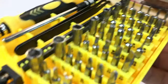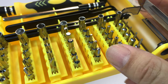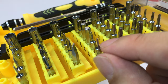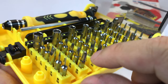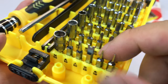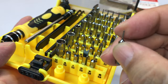So let me show you a couple of the bits here. You have the star bits with the hollowed out center. You have six-sided hex tool, like an allen key type of tool. You have a couple of really small flat head screwdriver bits and some larger ones. You have assorted sizes in Phillips from small to very small, and then right here you have another Phillips head, a triangular pry piece, and something like a pentalobe for iPhone cases. And then this one looks like a punch.